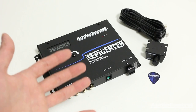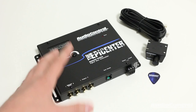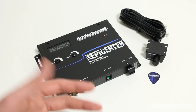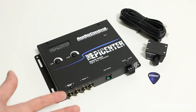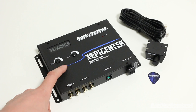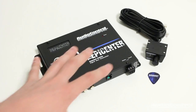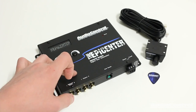You may be wondering why bass is ever removed from the audio signal during the music production process. This is done because most audio systems cannot handle true levels of bass. But if we're upgrading our car audio system, we are doing so with quality components that can handle the bass, so we need to restore it. Not only does the Epicenter allow us to recreate the missing bass, we can control the center frequency of the bass that is emphasized along with how wide a range of frequencies are affected, all while limiting destructive bursts that could potentially damage the speakers.